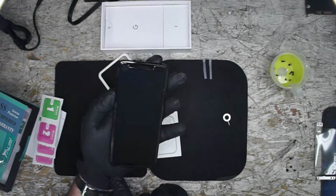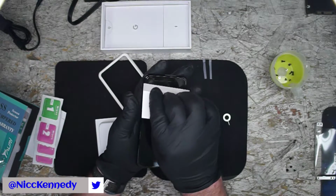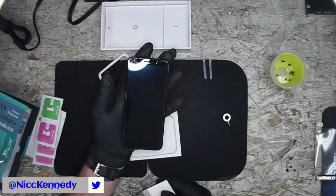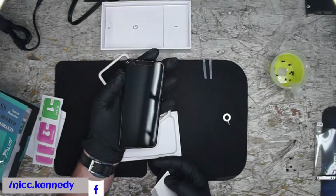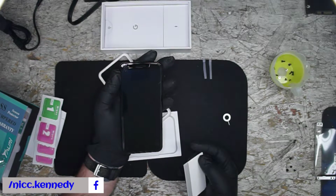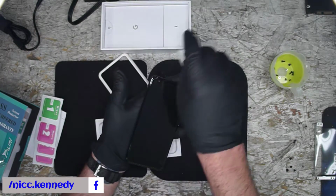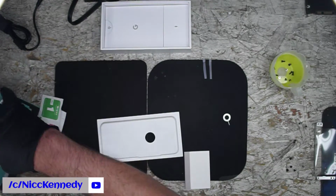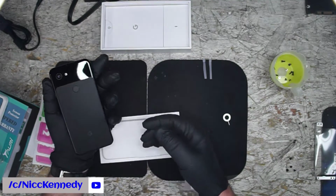And there's one of those pieces of dust. Like I said, they become the biggest magnet for static electricity, and they'll pick up dust from half a mile away as soon as you try to apply the screen protector. Most, not all, if you do mess up and you want to peel it back up, peel it carefully and wash it with Dawn dish soap under warm or slightly cool water, and you can knock that dirt off the back and usually get another shot at getting it to stick down. I'm going to say good.